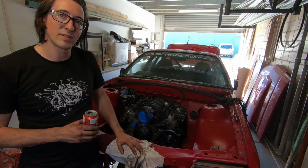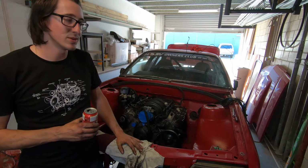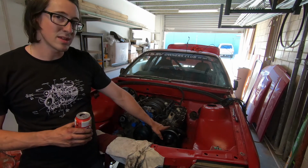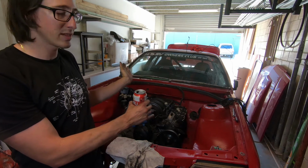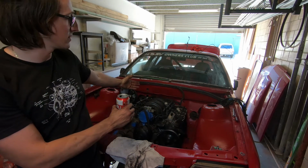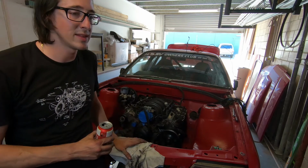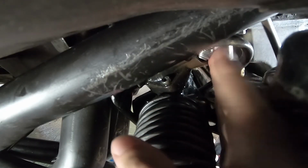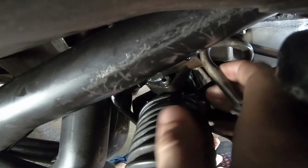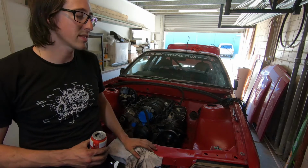And then we realized we hadn't put the power steering lines in. So we then had to put this engine mount in and took this one out, levered the engine up, so that we had a little bit more room, unbolted the steering rack so we could just move that a little bit. Tried to get the lines in, and in the end, they were too long, too hard to manipulate in because it was a big, lots of S-curves and whatever. So we chopped it in half where we can easily join it with some rubber hose underneath, like the K-frame area.